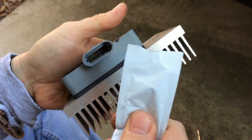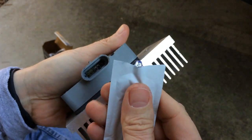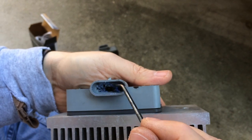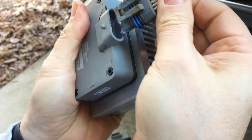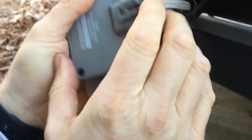In the kit you should have gotten some waterproofing dielectric grease. When you read the instructions it'll tell you to put this inside the connection — it's kind of a bluish clear gel-looking material. I just put a little worm of it inside here, then use the same tool I used to get the resistor out and work it down on the pins. This basically protects from corrosion and water intrusion. Then do the same thing on the connector itself, reconnect it, and push a little harder to get the resistor pack to seat until it clicks — at that point it's nice and snug.